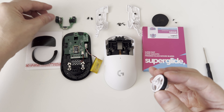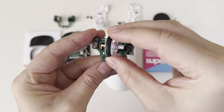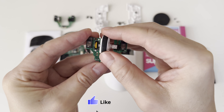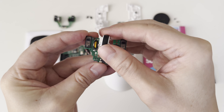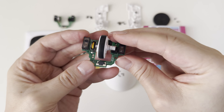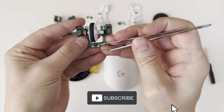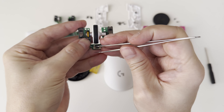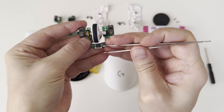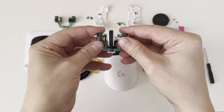Now I could either replace the bad switch by desoldering it and soldering in a new one, or use the hot swap board, but I am going to use the most convenient and fairly cheap option of the board with pre-installed switches. I have just plugged in the scroll wheel into the TTC gold encoder, which seems to be a bit wobbly on first try, so I am looking into replacing this one in a future video — stay tuned for that. Now let me prepare the connector by opening up the clip holder. I am using tweezers, which are fairly handy while working with small components on the board of the Logitech G Pro X Superlight.